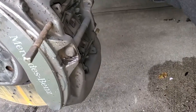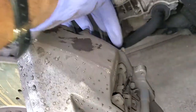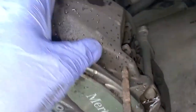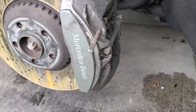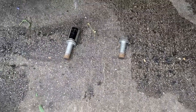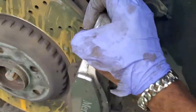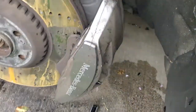Notice that the pins are basically out where my finger is at. What we're going to do is just take the caliper off and we'll be exposed to the brake pad. I got those two bolts out — the next thing is just to pry the caliper and it comes right off after you remove the bolts. I'm doing everything with one hand.